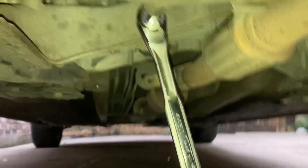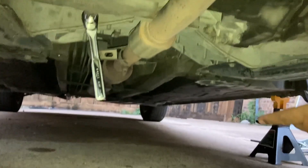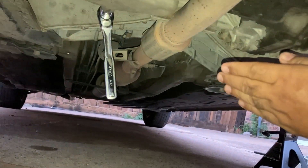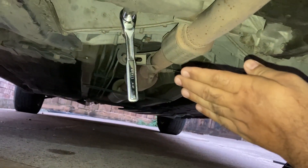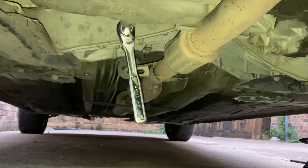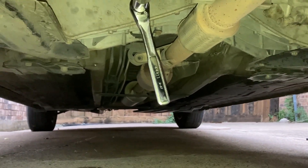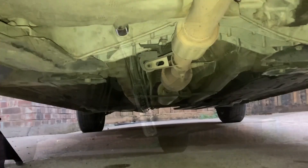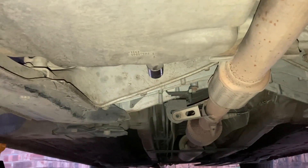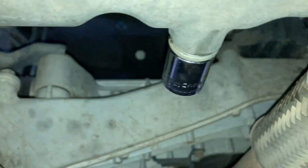What I can do is get on the other side of the vehicle and kick the ratchet — push it to loosen it. A nice little kick is going to open the drain bolt. That's one option. Or use the trick I have a video on, which is to use the scissor jack and lift the jack up to open the drain bolt. I tried to open it by hand, then decided to give it a kick — a nice little kick — and it opened right up. Gets the work done fast and easy.